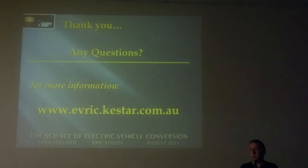Eric, what are the rules about reducing the weight in the engine bay? You're not allowed to reduce it by more than 50 kilos or whatever? No. You have to supply a weight certificate with the front weight, the rear weight, and the total weight. I did that. In actual fact, the car is a little bit heavier at the front than it was before. The reason is that I put the batteries between the axles, so the weight is distributed between the front and the rear axle. As an electric car it's a little bit more even, but it's still heavier at the front than the back. So they didn't care at all. They thought it was good.